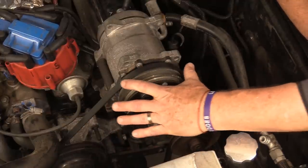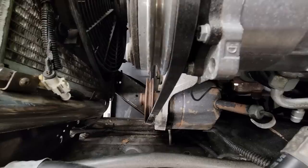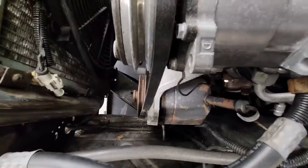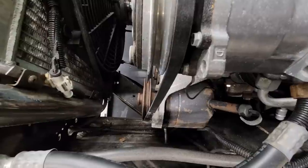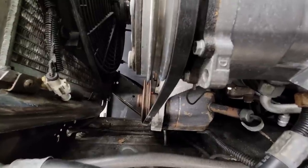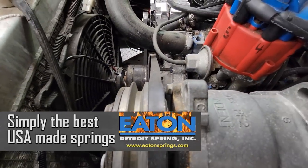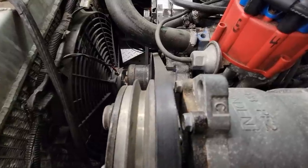If you don't have enough surface area, it's actually going to cause the pulley to possibly stop because there's just not enough traction with the belt. You want more surface area — more wrap around the bottom and back on this side so it's not just sectioning like it is right here. Our AC pump pulley only covers a small arc — that's not enough surface area. This makes it a lot easier to throw belts, and it's also bad for bearing wear on your power steering pump because of the amount of off-angle pull it's causing.